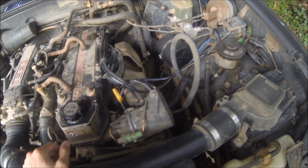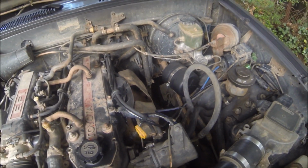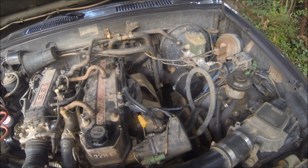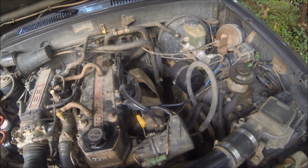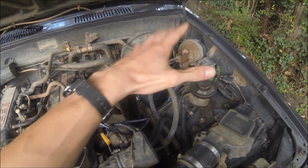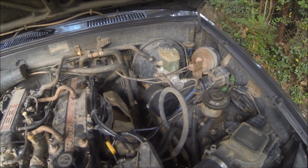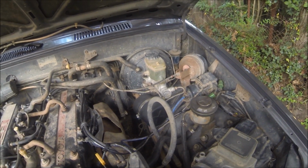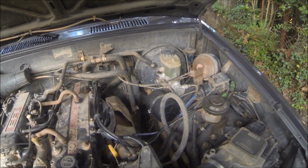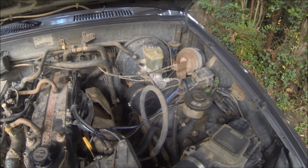And the last thing under here of note is the vacuum canister there. That's actually an ADD vacuum canister for a '95 4Runner, but I cut the mounts off of it and made my own mounts, and that supplies reserve vacuum to the cruise control module there, so that the cruise control has a larger supply of vacuum basically, and it seems to work a little bit better than what it did, so I guess it works.